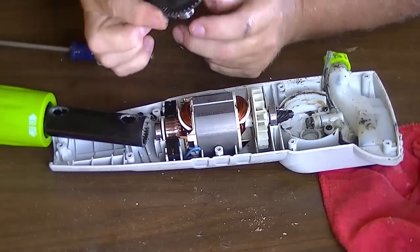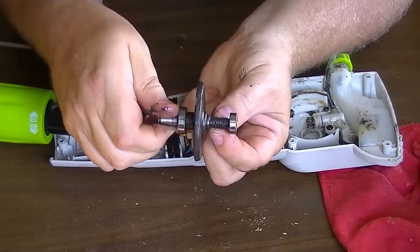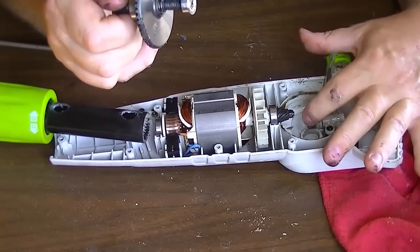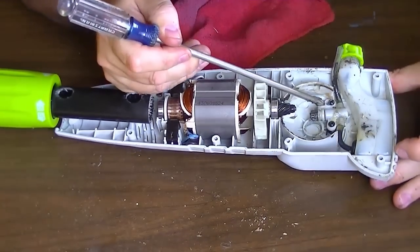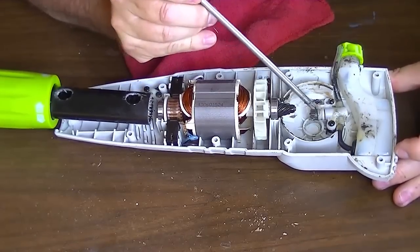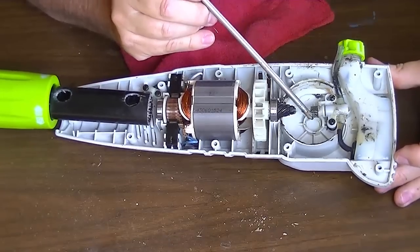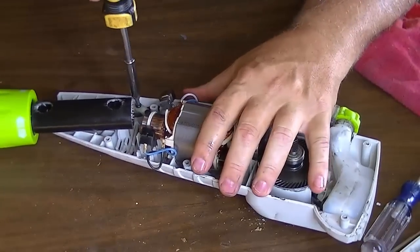It's not cam driven — it is gear driven. What drives the pump is a worm gear, and that worm gear drives the pump here, which really seems a bit flimsy. This whole assembly right in here seems kind of wonky — there's a lot of play. Maybe the gear just was not engaged while it was running and the tension needs to be adjusted. We're going to tear this apart and see what the heck is going on.